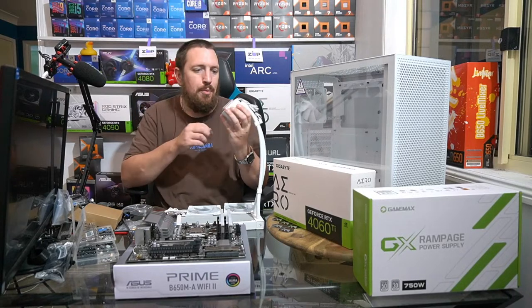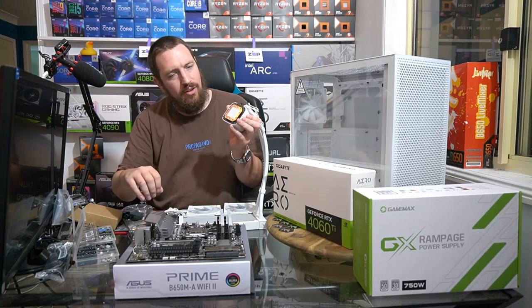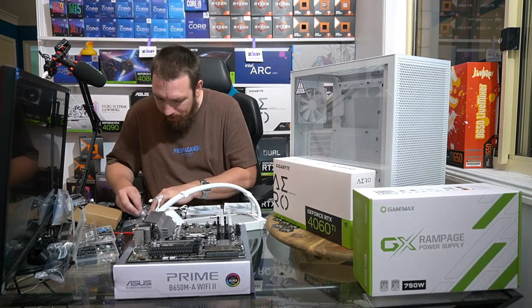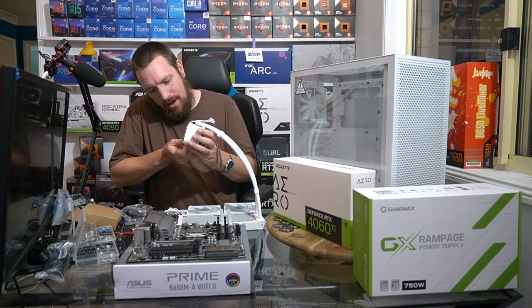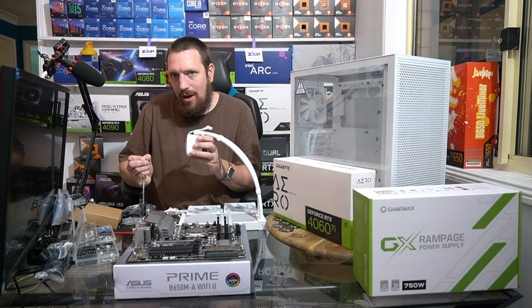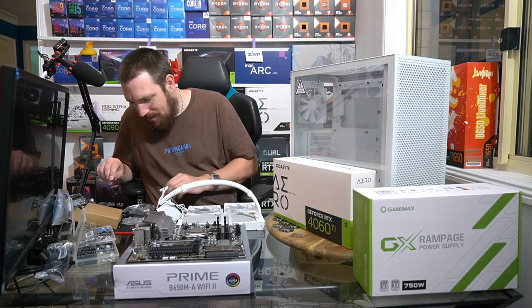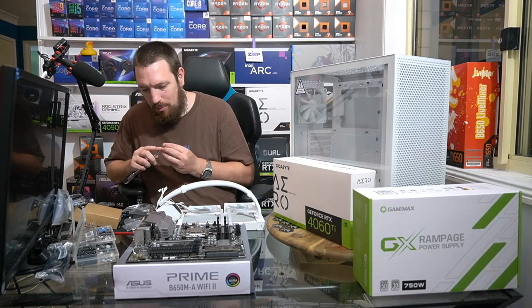So sometimes people ask me about thermal paste. There's thermal paste pre-applied on this cooler, and realistically that's all that you need. There are companies that sell high performance thermal paste and stuff like that, but realistically, you don't need it, okay? Doesn't make any big difference. People think that, oh, this will mean my computer will run like 10 degrees cooler. No, about maybe a tenth of that. That's what you're talking about. So, like, a degree difference. And then you'll spend like $50 for the little tube of it.